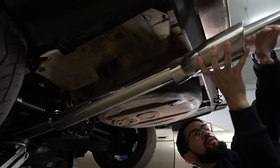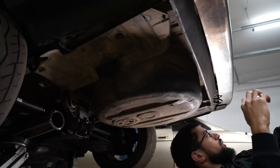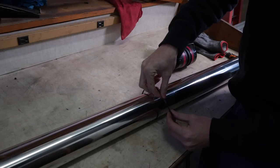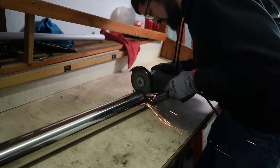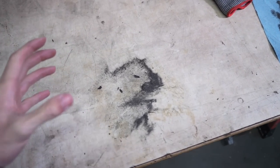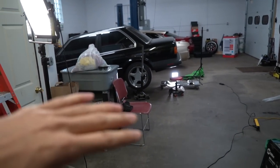I'm gonna hold the tip up and get it marked. The pipe falling just ovalized it a little bit. The problem is I don't really know exactly where this three-inch tube is gonna meet into this two-and-a-half inch tip. Got it marked - once again the zip tie trick coming in clutch. This angle grinder is solely responsible for the amount of smell you get inside a shop. Just cutting one pipe left all those metal shavings behind, so always be very cautious where the sparks land - don't do that towards car windows because it's literally sending all those metal flakes straight to your car window and pitting the shit out of your windows.